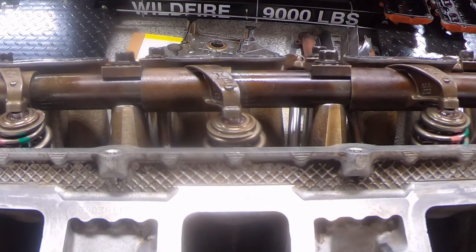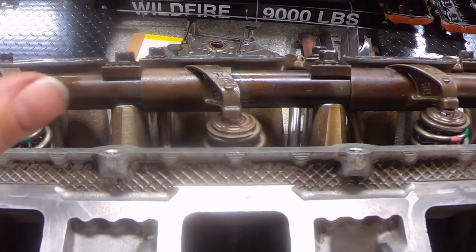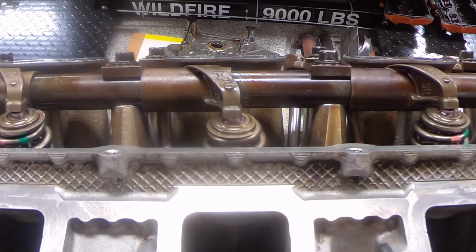I've got the camera on a tripod zoomed in on the number four cylinder intake. I'm going to rotate the crank with my assistant and we're going to concentrate on one cylinder head at a time. We're going to verify that all eight valves open and then close at some point in that rotation and make sure that nothing's binding.